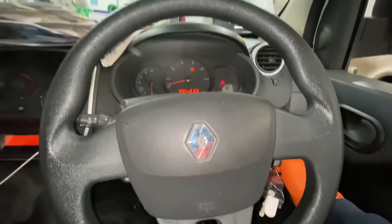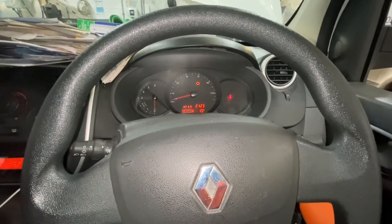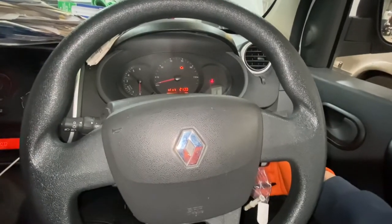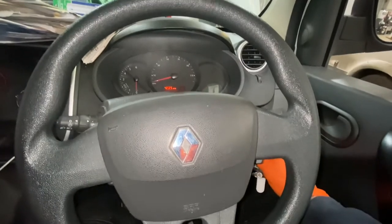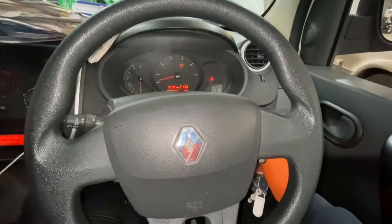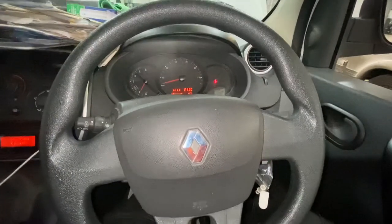Just leave it on for a little while, just so the fuel can circulate. Now turn it back off again. Now turn it back on. Then it should just start straight away, as you can hear from this video.